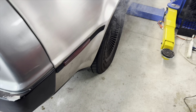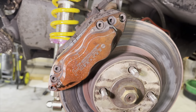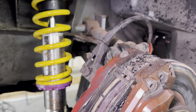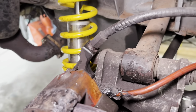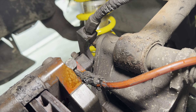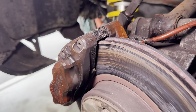Then I saw this. There was no fire, but it was hot. I almost burned myself getting the lug nuts off. I could feel the heat coming off the rotor from two feet away. The paint on the caliper had bubbled and the strain relief on the brake line had melted. The heat had loosened the brake line, which is where the trail of fluid was coming from. The smoke was from the fluid burning off the rotor.